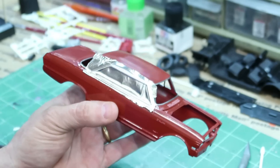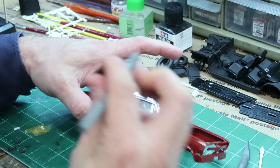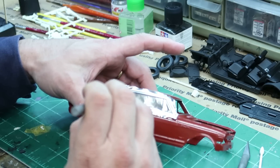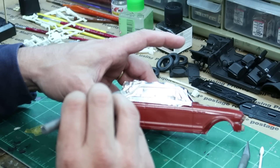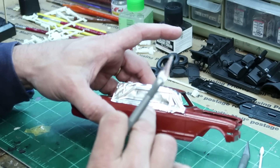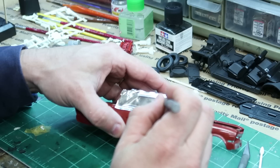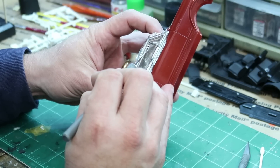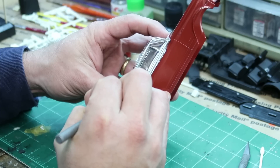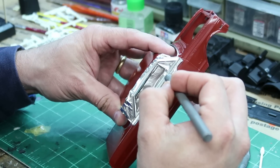When you get it firmly pressed around the edges, then we can cut the inner part out. Don't go ahead and cut the outer first — cut the inner. The reason I'm saying that: if you go ahead and cut along the outside edge, you only then have the foil that's on the chrome to hold it as you cut this out. So I find it better, because you have a lot more already stuck, to cut the center out first, and then you can go back and cut the outside last. Cut this center portion out, giving yourself enough that you can roll it inward but not so much that it's just going to be a big wad.